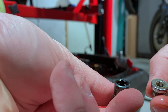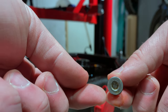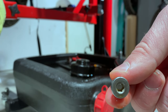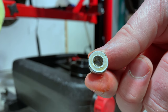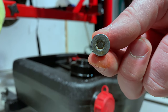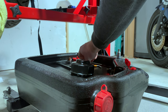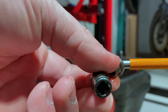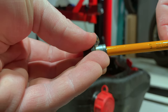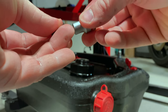So if you look at the bottom of them, you've got a significantly deeper socket. The problem with this thing is not that people will over-torque them — you really shouldn't, it's very low, basically thumb tight. The real issue is that it's not very deep. The odds of going in there blind, hoping you're fully seated and not stripping it out, is pretty high. What he's done is give people a much deeper socket. With a size 5 Allen key, the OEM goes in about that far. You don't have a lot of room to play with. With this one, not only is it much larger, but you have a lot more depth. The drive is a T40 and it goes much deeper.